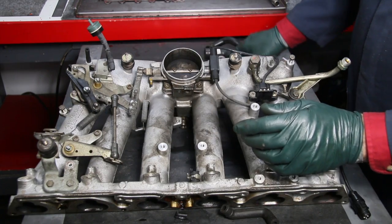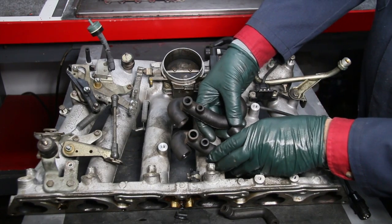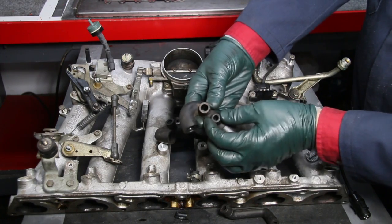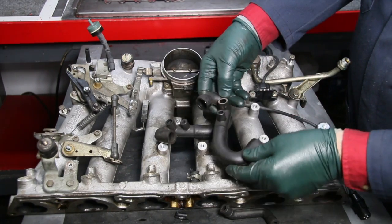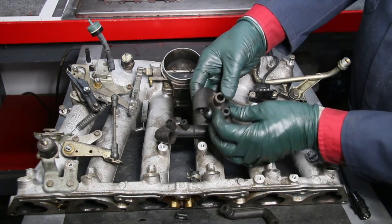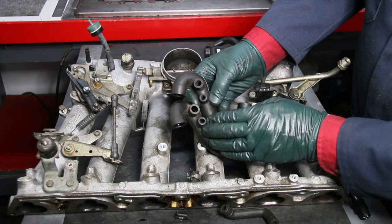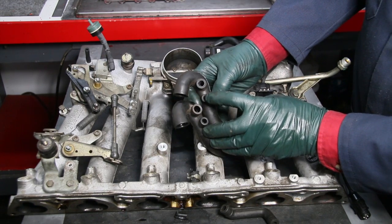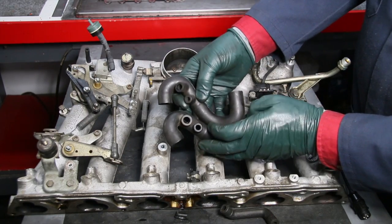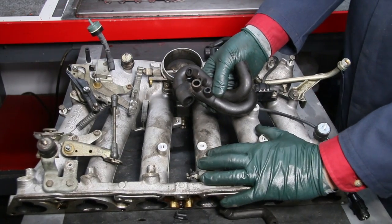Another thing that happens is when rubber parts harden, they will expand. Here is the original part — it's very hard. This one sits a little bit further from the cylinder head, so it's not rock hard, but look at the difference in the size of the holes between the old part and the new part. The cold start injector fits in here. You have to watch for leaks, because any air leaks in the system mean your engine won't run properly and will be very hard to tune.